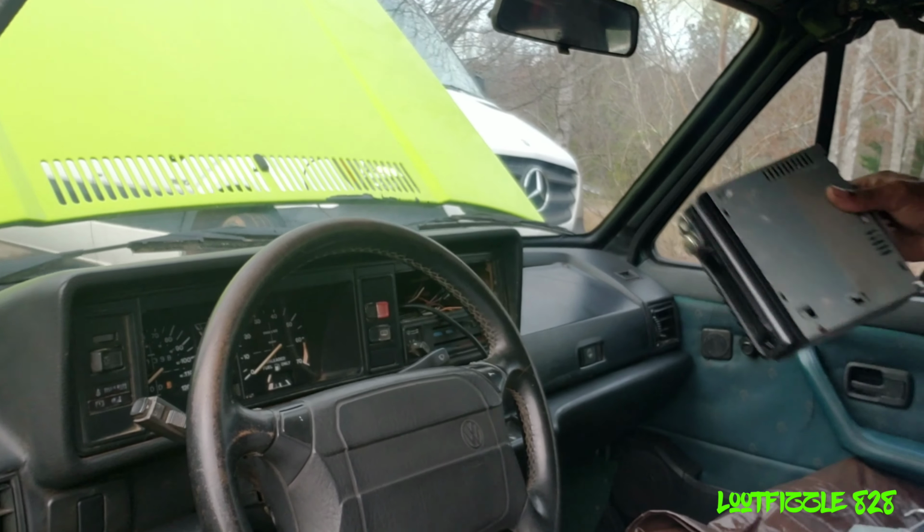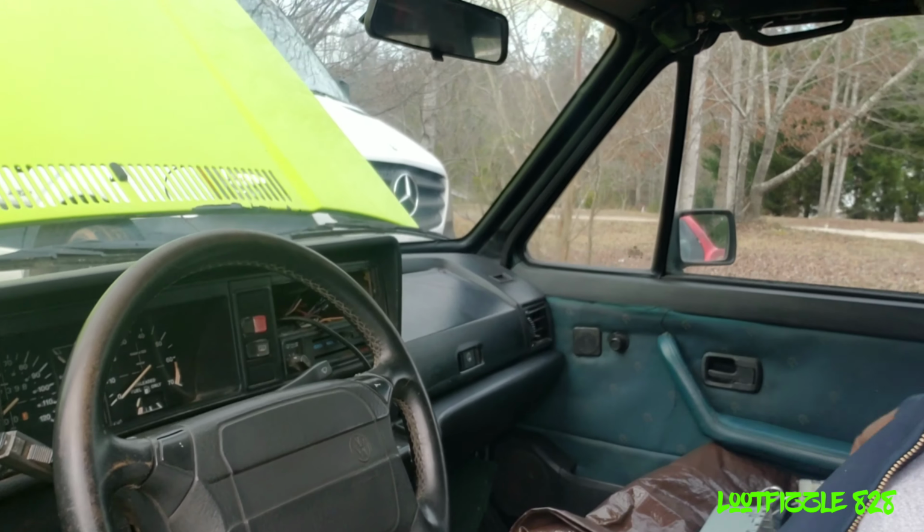And then I noticed as soon as I hooked power to the car, that this radio right here just stayed on. The guy that I got it from, he got it from some people. And I think that it was just a hodgepodge project for them. But I don't think they knew what they was doing. I'm here to the rescue now. So I disconnected that radio, and as soon as I pulled it out, I noticed that they had the accessory wire straight wired to hot. And you can't do that, because then the radio just stays on. If the accessory switch is hooked to the hot, then it just stays on. And I believe that was part of my problem that was killing the battery.